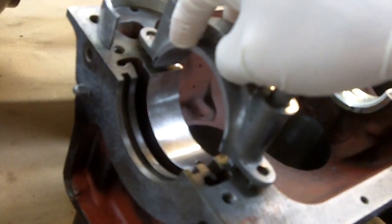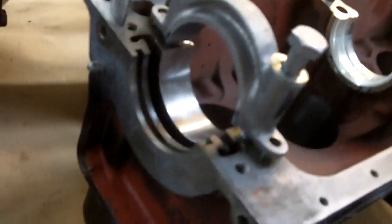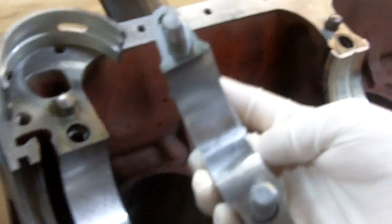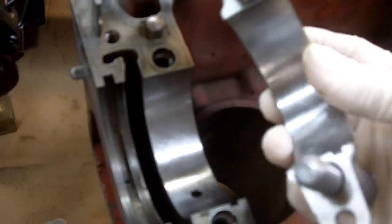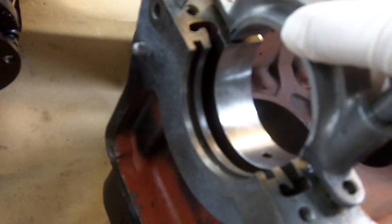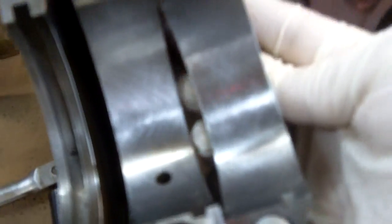That could be because the cap distorted from abuse of the engine — the engine ran out of oil — or perhaps the machining tolerances at the factory were not 100% right. The end result is you want to blueprint the engine according to the factory specifications. The way you do that is you physically remove material from the cap where it seats against the block, shrinking the hole, then go in with a very large machine device — a long steel rod or tube with cutting stones on it — to make the hole the proper diameter. You can see how nicely machined the surface is.